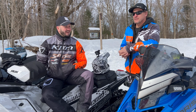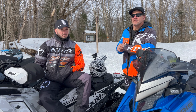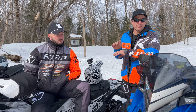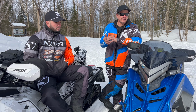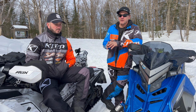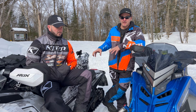So I definitely valved it stiffer. If you watched the videos before, you know the Assault is set up, valving-wise, for more off-trail riding, where it's rigid in the small stuff and then blows through when you're hitting hard trail stuff. As soon as you come off something, it just goes right through it. When we took them apart in the video, it was valved exactly the way it feels, no question. So when we made the change, I stiffened things up front and rear of the rear suspension.